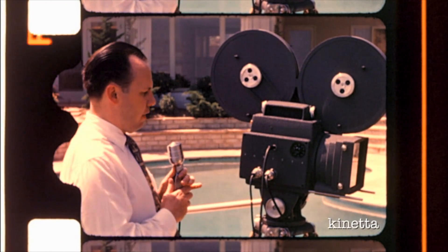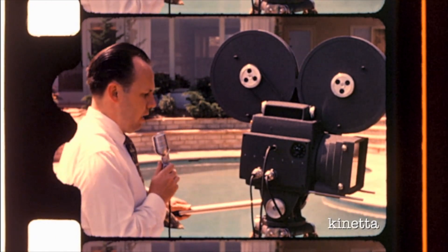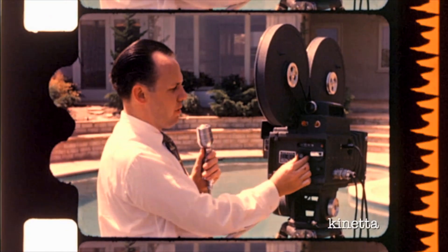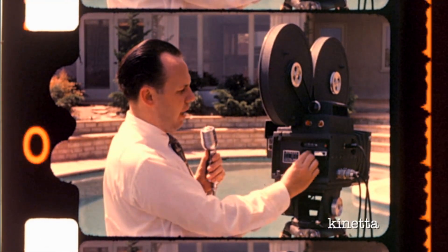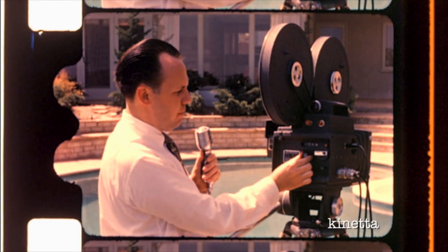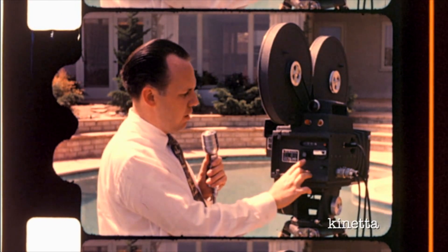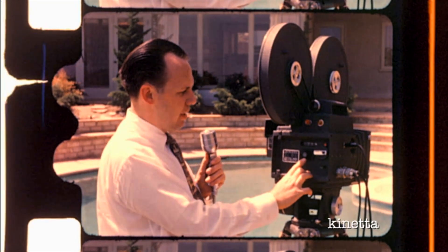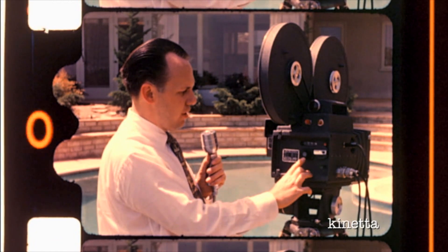The Super 1200 camera is equipped with this eyepiece located in the back of the camera, which can be set to individual eyes by twisting it, which sets the focus of the optical system. This eyepiece works with both the telephoto finder system and the ground glass focusing system.